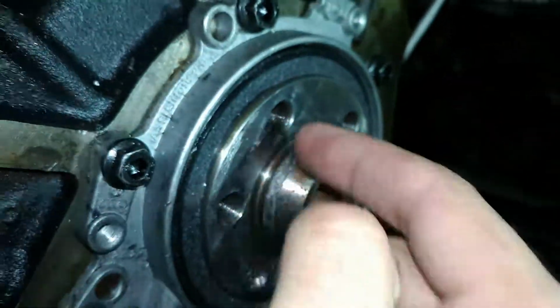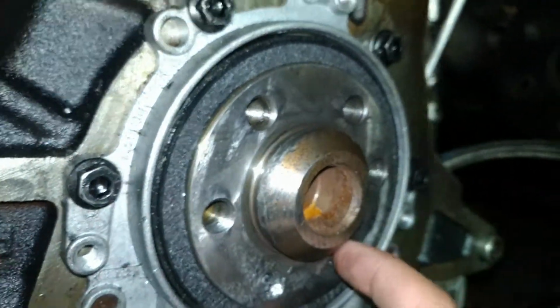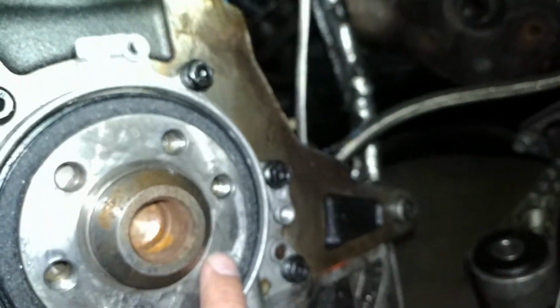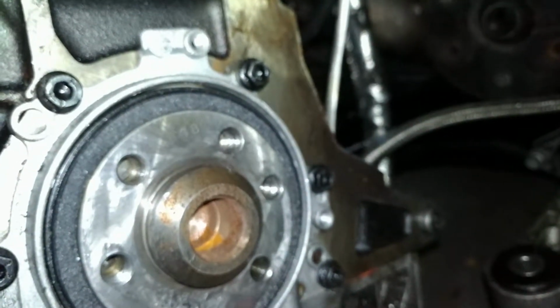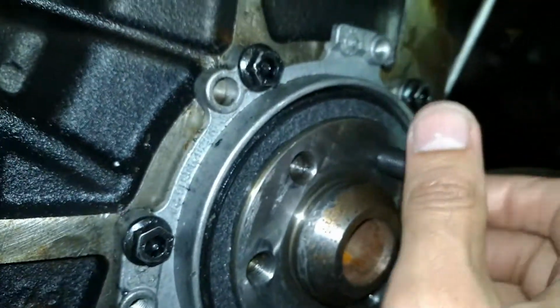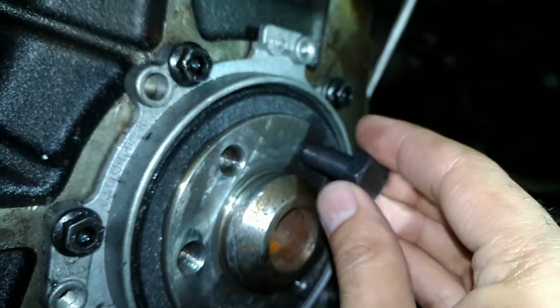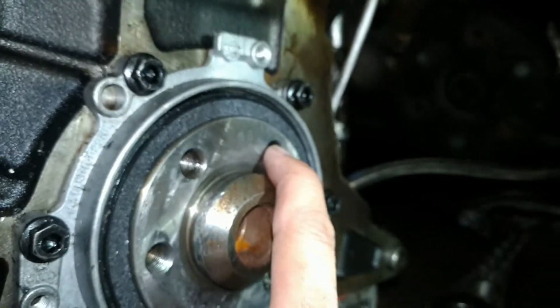Like I said, these were the ones that just kind of fell out. The ones on the side here were of the 3 bolts that had backed out, so those came out when I took the flywheel out. I originally was not able to screw this in, but after I ran the tap through, I can reuse them. So I'm no longer freaking out.